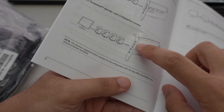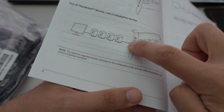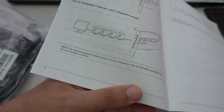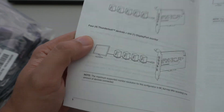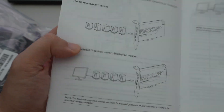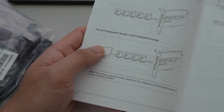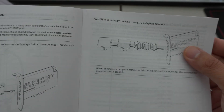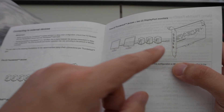If you have a video signal in the composite Thunderbolt output, the DisplayPort signal will output to a monitor provided it supports that data link — usually via a USB-C interface on the monitor. You could also do three Thunderbolt devices and two DisplayPort monitors, all off a single Thunderbolt 5 port.